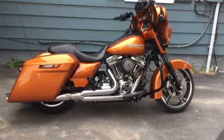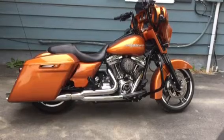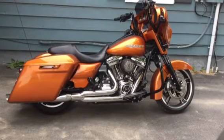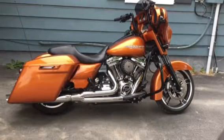I ended up trying two different baffles on a Dragos 2 exhaust — the 2.5 and the 3.5 inch baffle. Hands down the 2.5 outperformed the 3.5 inch by about 10 foot-pounds of torque from the bottom up to about 4,000 RPMs. You can definitely feel the difference when you ride the bike by swapping out the baffles.